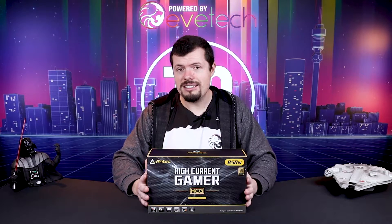Most gaming systems usually average between 300 and 400 Watts, so this should give us some headroom to do even 2080 Ti SLI. Quick math off the top of my head: both cards doing 300 Watts each plus 120 Watts for your processor, you're looking at about 720 Watts, so this should power that with absolutely no problems. There are a couple of nice little bits and pieces that Antec have done with this, but this is a compact series power supply, so we're going to do the unboxing now and see how small it really is.